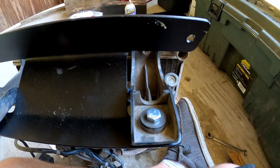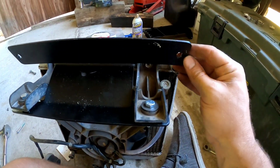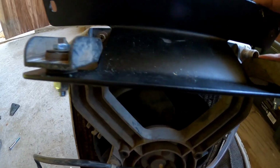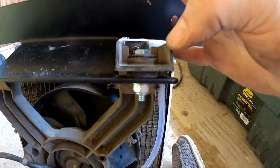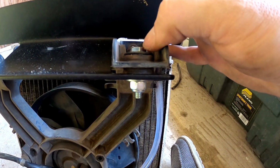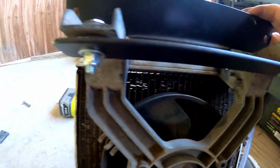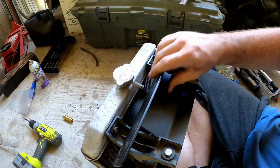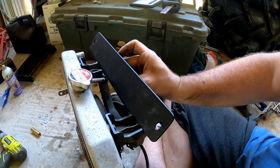All right guys, just want to show you here before I move on. Take the big shape bracket that's going to go underneath here. You said you already got your grommets in there. Take the little bolt that comes with a kit, put a washer and a nut, tighten it down. They're both 11 millimeters, and it'll sit just like this, so we can move on to the next step and mount the other bracket.